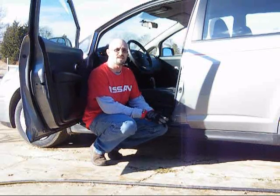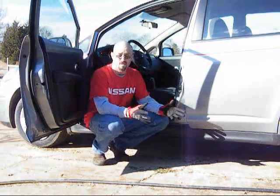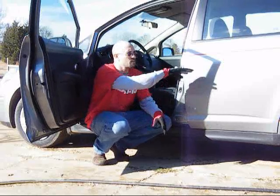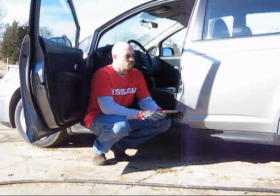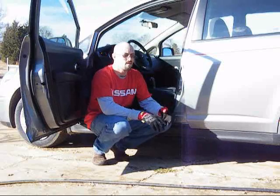Now on the side of the tire, it does say a maximum of 44 PSI with an 1,130-pound load. What that means is if you were to add roughly about 1,400 pounds of weight in the back of this Versa — and it will fit, believe me — you want to raise your tire pressure from 33 PSI up to 44 PSI in each tire.